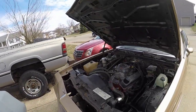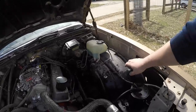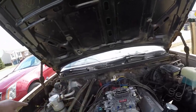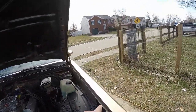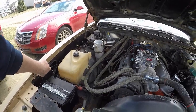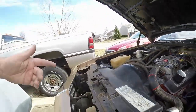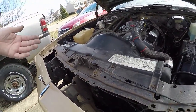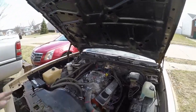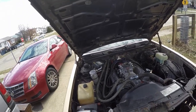We're going to go ahead and get this thing jacked up, get some of these hoses off here, and some of this wiring too. Look at this — this here looks like it's for a cooling temperature gauge. It actually starts back here and runs all the way around the whole car, which is really dumb. I hate these bright yellow connectors — I want to get rid of those too. And for some reason he has his factory mechanical fan plus an electric fan. When one's not running, the blades are like blocking airflow — it's stupid, so we need to get rid of that too. We're going to clean up a whole bunch of stuff underneath here. This is the before shot, and now we'll go ahead and take it on a test drive to see how she runs.